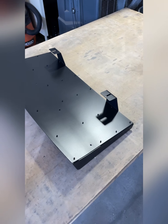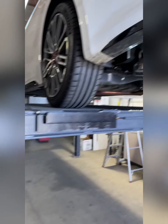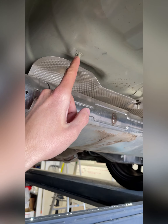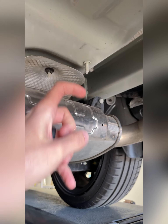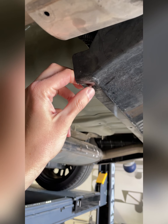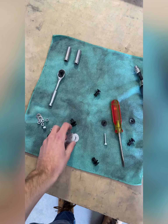After removing the tray, identify the slots in the diffuser. You're going to slide the diffuser onto the outer studs where the 10 millimeter nuts were. With help from a friend, have that person hold up the back of the diffuser so it doesn't droop while you're installing it onto those studs. Use a small washer and a nylock nut and get them almost tight but not all the way — you want to be able to move it on those slots. The four holes in the diffuser will install using a 5 millimeter spacer with longer bolts — M6 by 1.0 by 30 — and nylock nuts on top with larger washers on top and bottom.